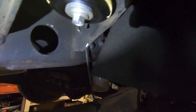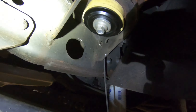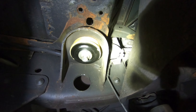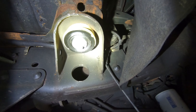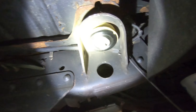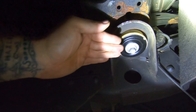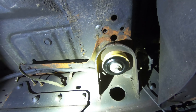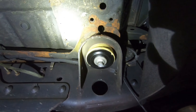We got the new ones in. They did squish down quite a bit, so they didn't stay the same height as before. That bolt is 15 millimeter and you want to torque it to 85 foot-pounds. I had trouble getting this one out — it was rusted, the two pieces rusted together — so I just used an angle grinder, came in from the side, cut it in half, and broke it off. Anyway, hope that can help somebody. Thanks for watching.